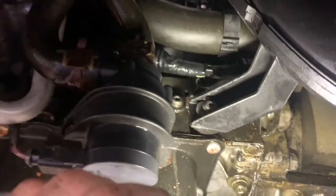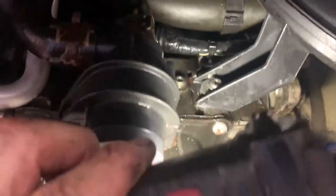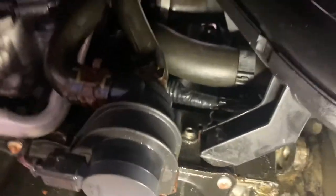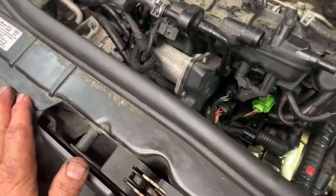There are two bolts on the side of the block — one here and one above that other hose. Now push that hose on and get it on, and plug the sensor in — it sits in between those two bolts. The lower one's on, so go do the throttle body and then line up the bolts and tighten them up.